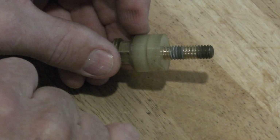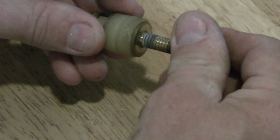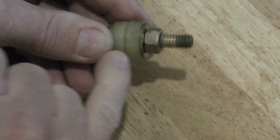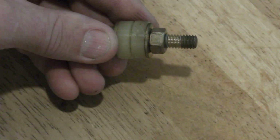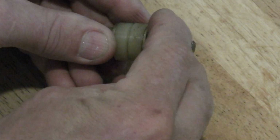Inside the vehicle, this is what provides the clamping force, this nut here. So you don't need a nut there, but I like to put one on just to stand off those brown power leads that are inside the vehicle from the plate. This is where the rear bulkhead connector plate is, and so this will stand off those power leads. I have plenty of thread. There's no penalty to putting another nut there.